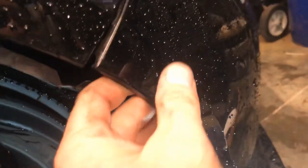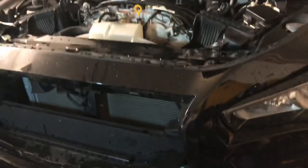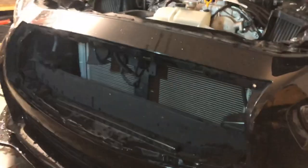If you can get some light in here — this little guy here allows you to separate the bumper from the fender. Be careful, there are little nuts in there and those little clips. Pop it out. Well, it's out. But I gotta say, just take the bumper off — it seems like it would be way easier. It's tight, get down in there. Some of them didn't want to pull out, so it's a little rough. But we got it out.